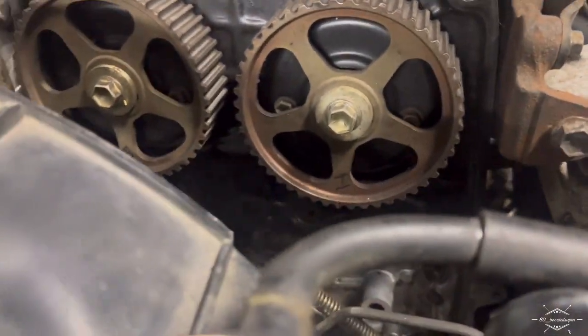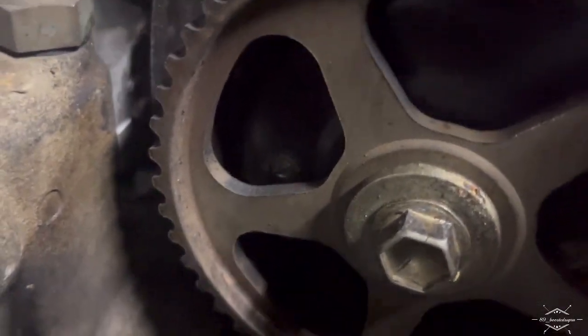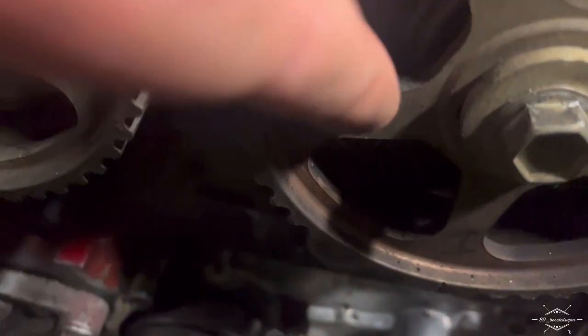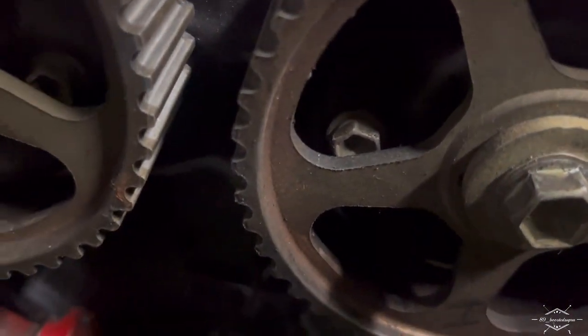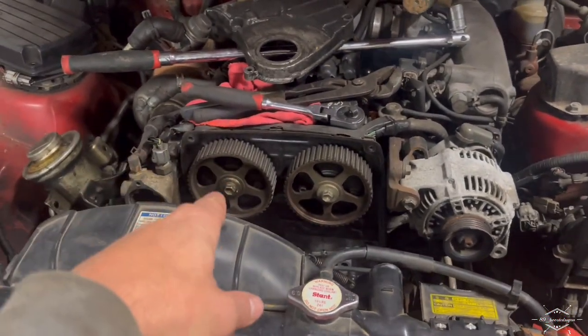I don't know where that bolt came from. Actually — yes, I do. Look right there. Boom. Broke it off. So that bolt is gone. It holds that cover. The cover's getting tight because of that bolt. So when I turn these cams I'll check these bolts, but that's what happened. This cam gear hit the bolt somewhere and broke that bolt off, got down in there, and tore that belt up. So that's what happened, y'all — there's the culprit.